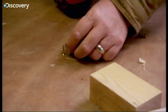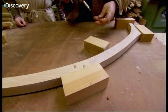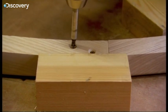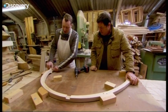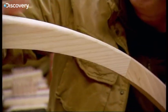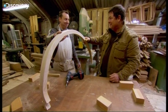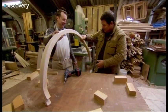We put the two screws in, take the wedge out, and you've got a complete wheel arch. That's one completed wheel arch for a fantastic Morris Traveller. There's just another one plus the other bits of frame to go — it's going to be a long day. Getting that far takes quite a bit of craftsmanship.